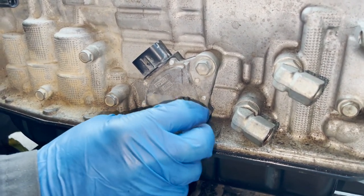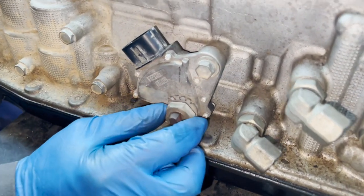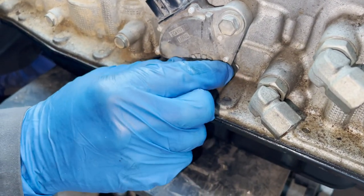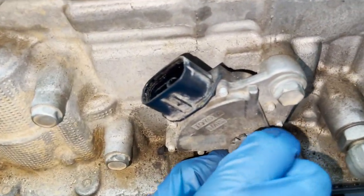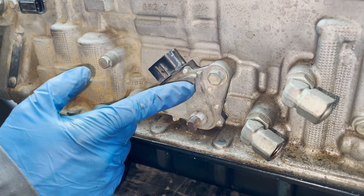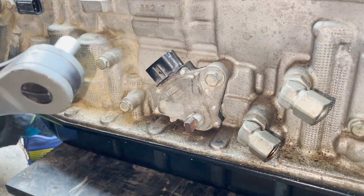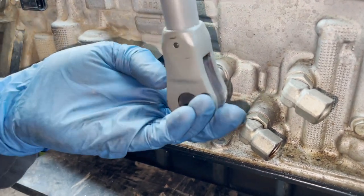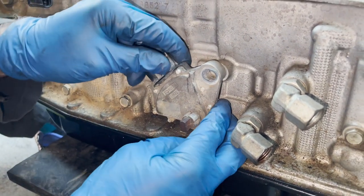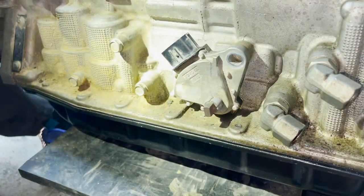This is on very light torque spec, that's why they have this special claw washer to make sure it doesn't come off. I've got to slide the washer off too. There's a 12 millimeter bolt that holds the park neutral safety switch to the transmission - I'm going to zip it out with my Milwaukee ratchet. Now let's see if I can wiggle this thing off the shaft - just be gentle with it, there's some trick to this.